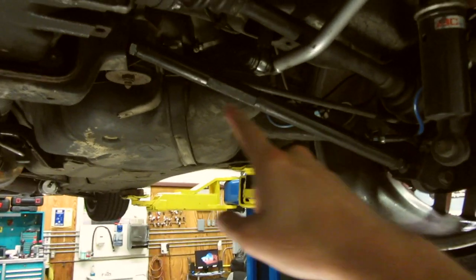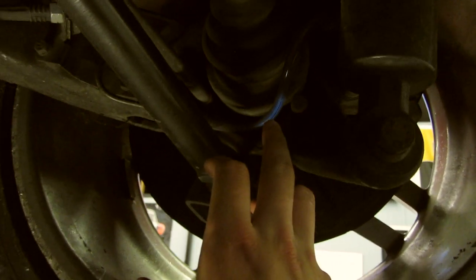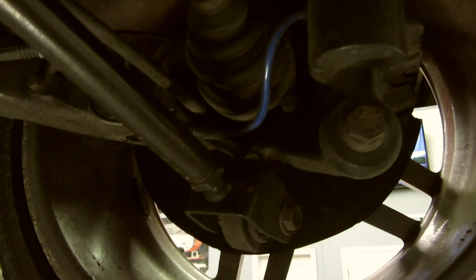And on to the rear of the car, we have these adjustable rear control arms. Those are SPC. Ordered those off of eBay. You've seen I have braided lines for the brakes. My very first event ever, we went out for like our second or third run, pulled the e-brake and popped a line. It busted and I had no brakes, so we had to go find a line and make it work. And since then we have discovered that putting these lines on will prevent that from happening again, ever, hopefully.